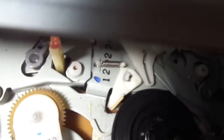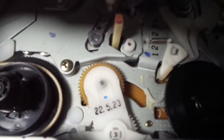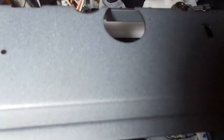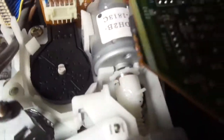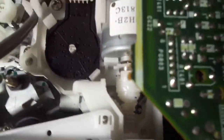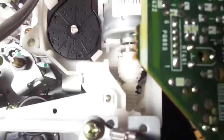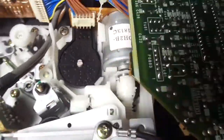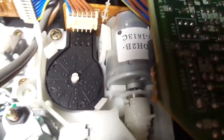You can see this is a geared idler — it's not an idler tire. I heard these idlers can get worn out according to Studio Sound Electronics, but this one isn't worn out. Here's the loading motor assembly. And here's the mode switch — you don't see a lot of VCRs with a mode switch right next to the loading motor, so that's pretty rare.